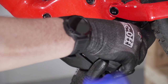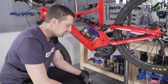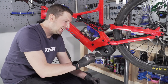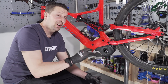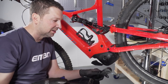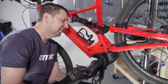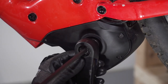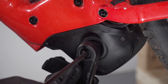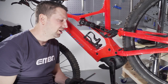Replace the cover bolts one by one — from the factory these come with Loctite on them, and it doesn't hurt to add a bit of thread lock. When doing them up, they're only 1 Newton meter and you're dealing with plastic here, so don't use the full length of the Allen key — just nip them up firmly, not even tight. Then install the left-hand crank arm. Put a little bit of grease on the splines, locate it in line with the splines, apply a little pressure and you should see it line up. Wind the bolt on — you can add a bit of Loctite if you see fit, but from the factory it has quite a lot on. Just do it by hand initially to give purchase when doing up the lock ring on the other side.